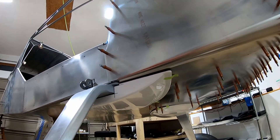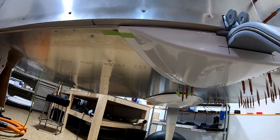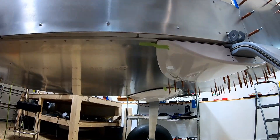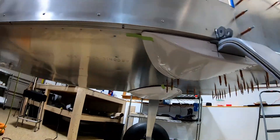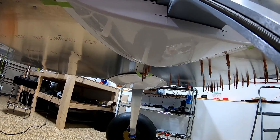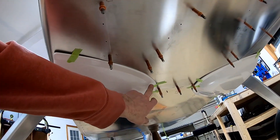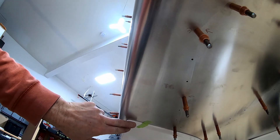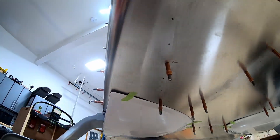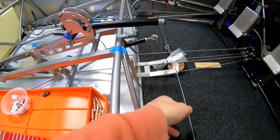I've got to be honest — I really don't like the threaded rivets they give you. They're the same ones that are in the headrests and I had one spin on me, so I'm going to see if there's a better solution. They also give you five for each side, which puts a middle one right in the center. I've seen people do six — three on each side — and I probably wouldn't be opposed to doing three 8/32s because I have better thread sets for 8/32, and it'll prevent the middle one from being right in the center.